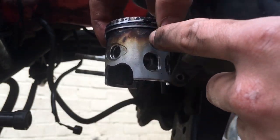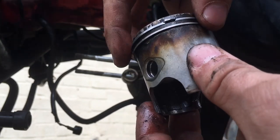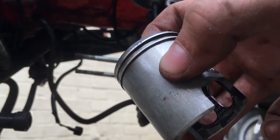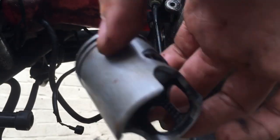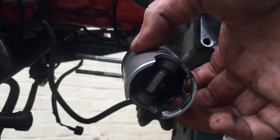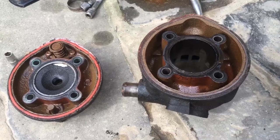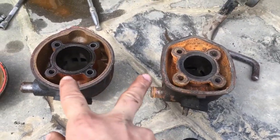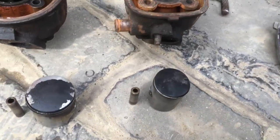By all this marking on the piston I can tell there's quite a bit of blow-by, so I'll need to either get a new piston or clean this one up and get new piston rings. Here is my old 50cc piston — quite a lot of miles, but there's pretty much no blow-by at all. As it's just going to be a quick run-around whilst I get the DR70 helicoiled, I'm going to put it back in with the same rings. Here's a size comparison — you can see the difference in the bore and piston going from the DR70 kit back to the 50cc stock head, barrel, and piston.